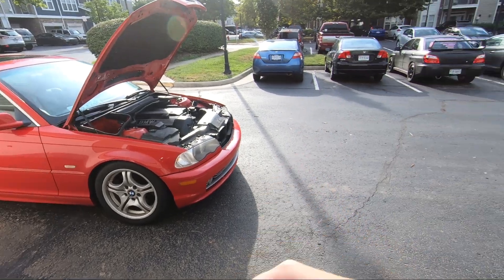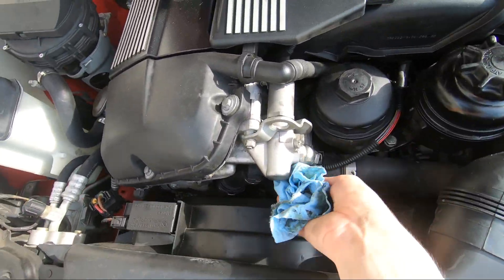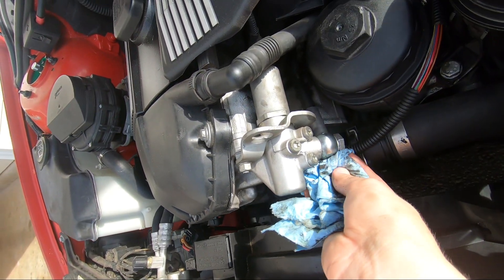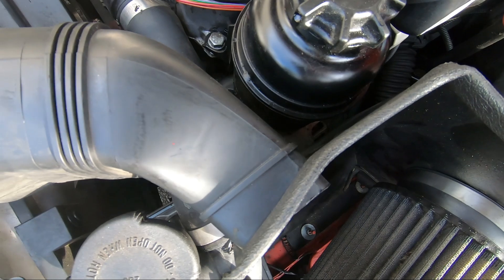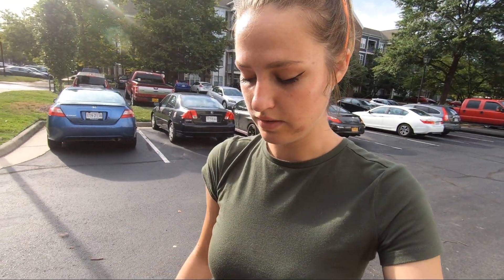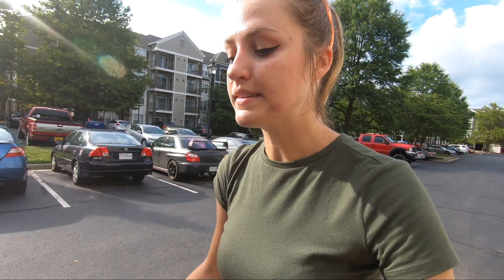We're back — I went ahead and did a few pulls on the highway, nothing too crazy, got the BMW up to temp and up to speed. I can definitely smell oil burning off the block from the old residue. Trying to see if there's anything under here still leaking — it doesn't really look like anything crazy. I can't see anything obvious, so I don't think that line is leaking anymore. I think to find the next oil leak I'll need to clean everything up underneath again and drive it for a day or two to see where new leaks show up.